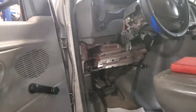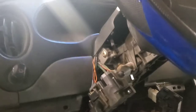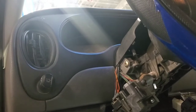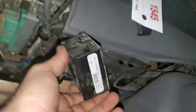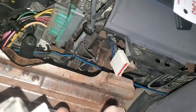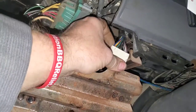2003 E350 Econoline — the customer has been working on it themselves. I have a switch that is not actuating the wiper motor and not turning on the pump. We're going to go through some basic preliminary stuff up front. The fuse — fuse nine right here — has power on both sides. Then come up here to this module stuck up under the dash. You'll have to bend the bracket down some, pull it out, and unhook the module.